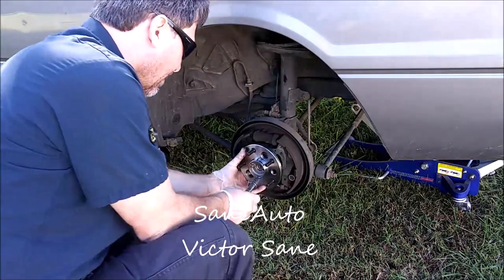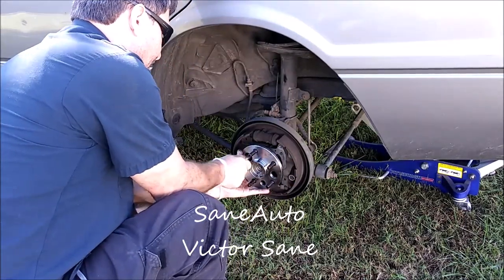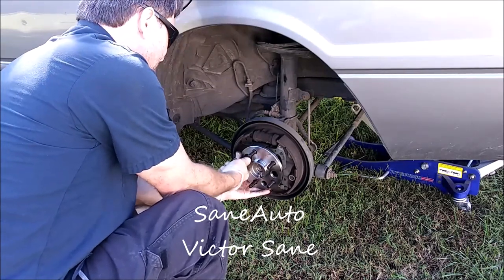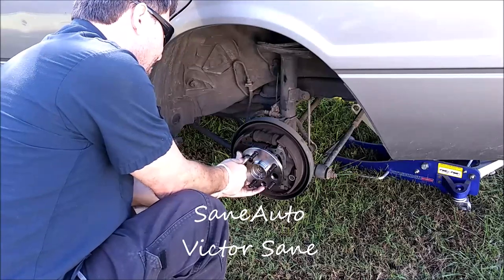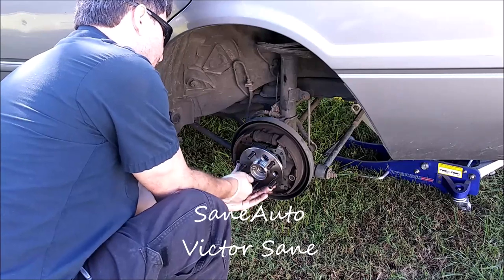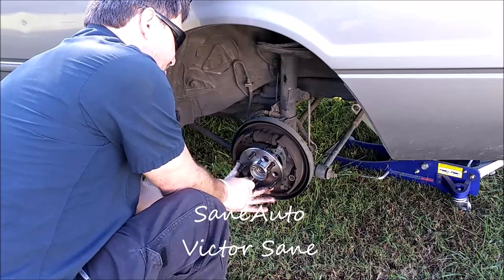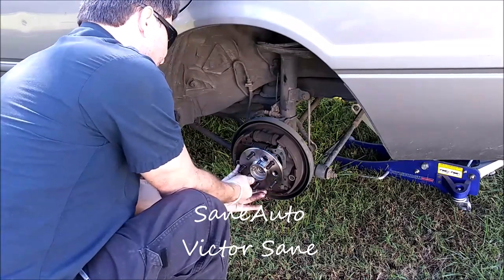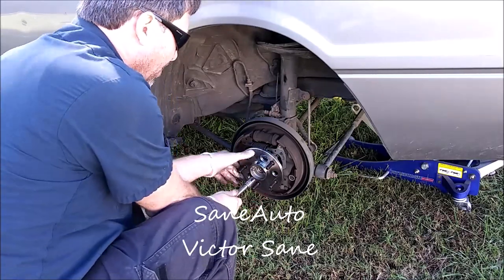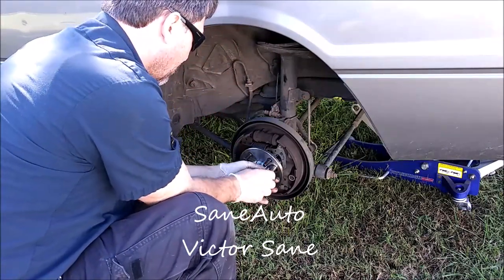Now take this off of your air gun. Spin the big hole around. And get everything started by hand before you ever get an air gun anywhere near any of this. You don't want to turn an easy job like this into a big project of trying to get out a cross-threaded bolt, chasing threads, buying a new bolt.